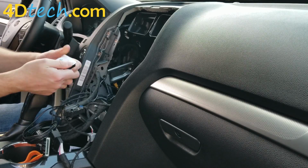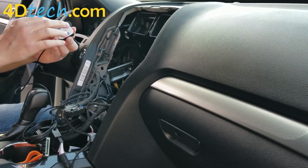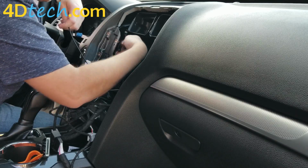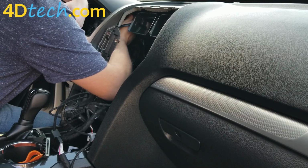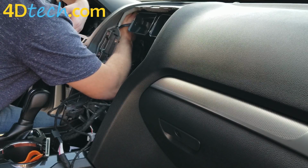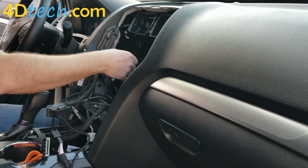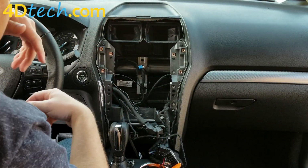So you'll put one side of the sticky side pad on whatever surface you're going to adhere it. In this case, I'm doing it to the bottom of the dash pad, so I'm going to put it on the top of the antenna. Then peel the adhesive off the other side, and we'll reach up to the opening and you see I'm pushing it up firmly right underneath the plastic of the dash pad here. That will give plenty of signal for the Sync 3 through the windshield.